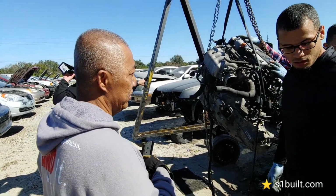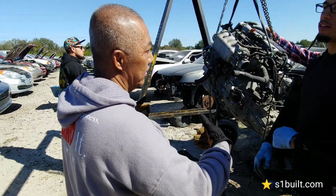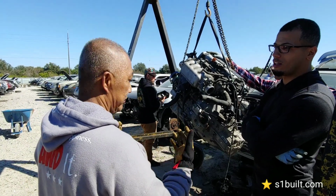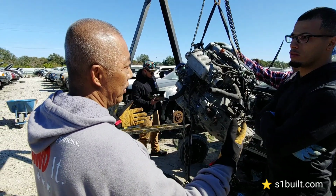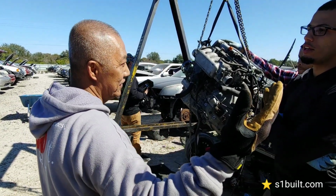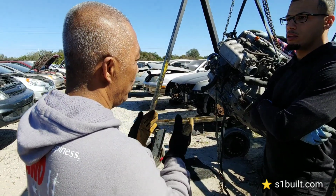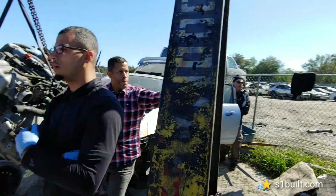What did you guys get? 5-lug? I don't know about the 5-lugs. Now, it's easier to do the 5-lug conversion and then all-wheel drive. You take it from the CRV, the front. The front spindles are the same as the Type R, aren't they? Exactly the same. And then the rear, you can use our all-wheel drive arm. Now you go 5 lugs, the same price as going all-wheel drive. Makes sense, right? Yeah. So y'all heard that?